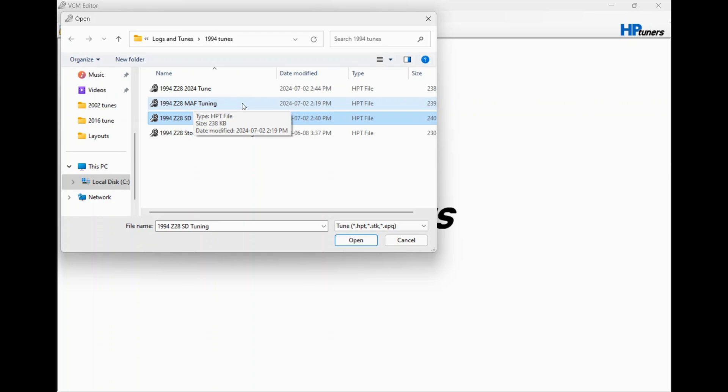Then you do the MAF tuning, which is a lot quicker — I did that yesterday. I still have to do more for the wide open part, but as far as drivability goes the car drives really good now, whereas it didn't run that well with the tune that came with the kit. Also, HP Tuners doesn't come all set up to do this stuff — you have to set these tunes up and set up a histogram in the scanner. I'm going to put two links in the description from Goat Rope Garage; he shows you how to set these up. He's already got videos up for it and he's a much better tuner than I am.